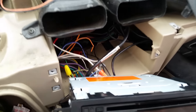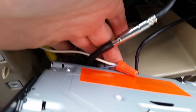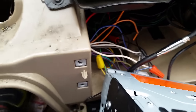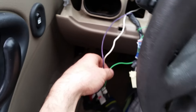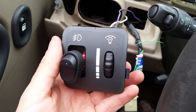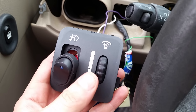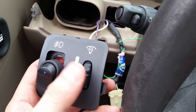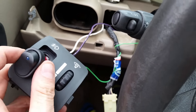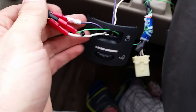What I found is that you can hook up the blue and white remote wire — which is right here coming from the Pioneer deck — and I spliced a white wire into it and ran it all the way over to the other side where I have this switch. It's in the location for the interior light and fog lights. My model doesn't have fog lamps, so I grabbed this switch from a junkyard and it fits nicely in there.